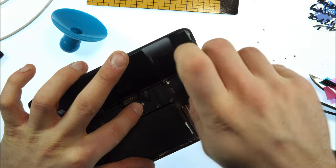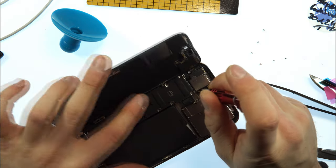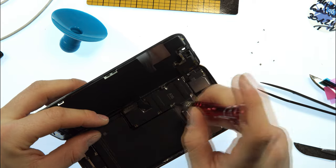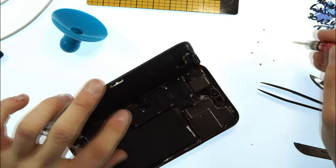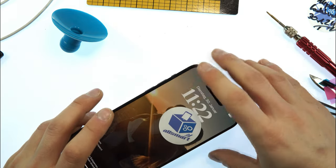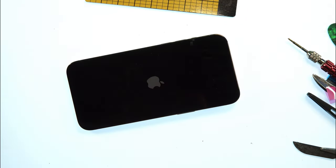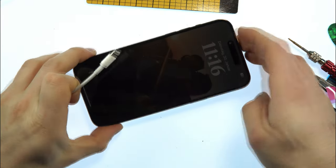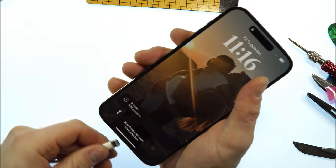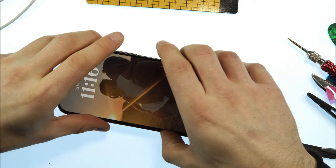And that's the reason why the display was not closing as it should. There was a little space between the glass and the metal frame that shouldn't be there. And yeah, that's why the device was not closing perfectly. But now it should. So now, is everything correct? Now you see the sheet plate is underneath here. We now take the battery pack and try if the charging port is working. And as you can see, the charging port is just working perfectly fine. We switched the positions to the upside, working perfectly fine. The repair was very successful, and the charging port replacement worked as we wanted.